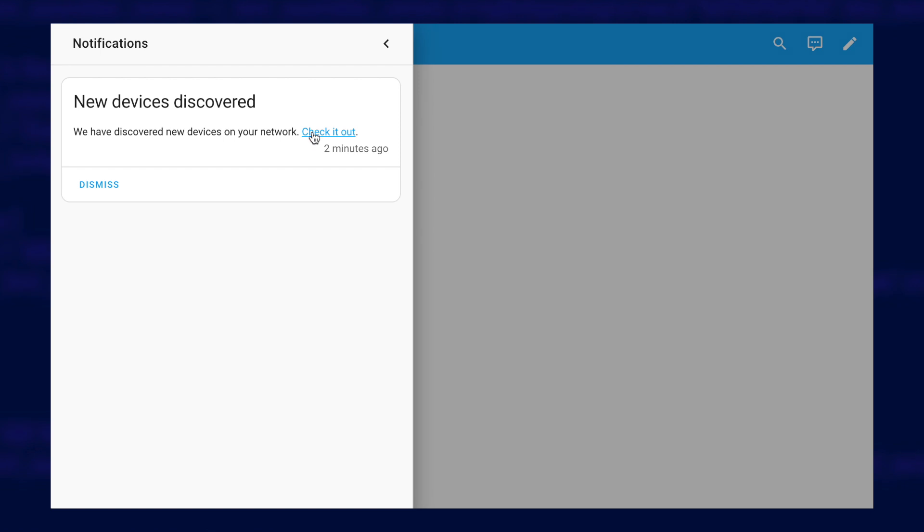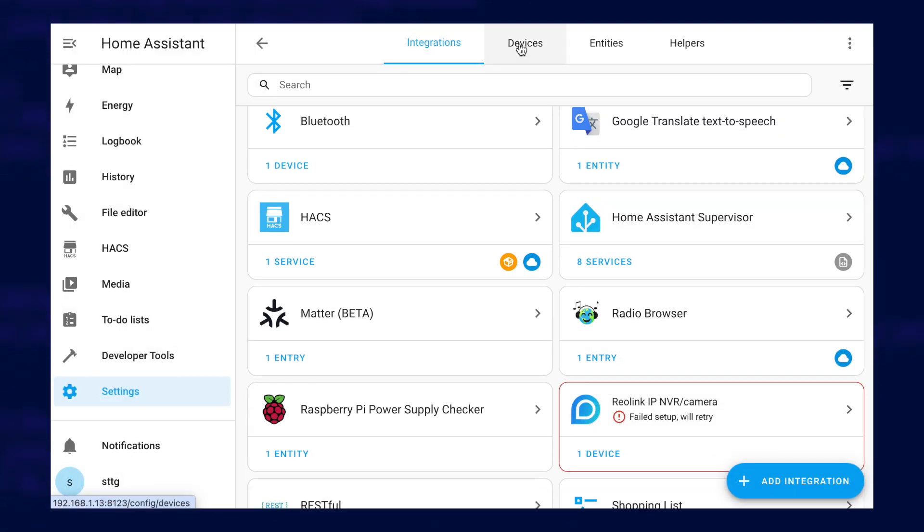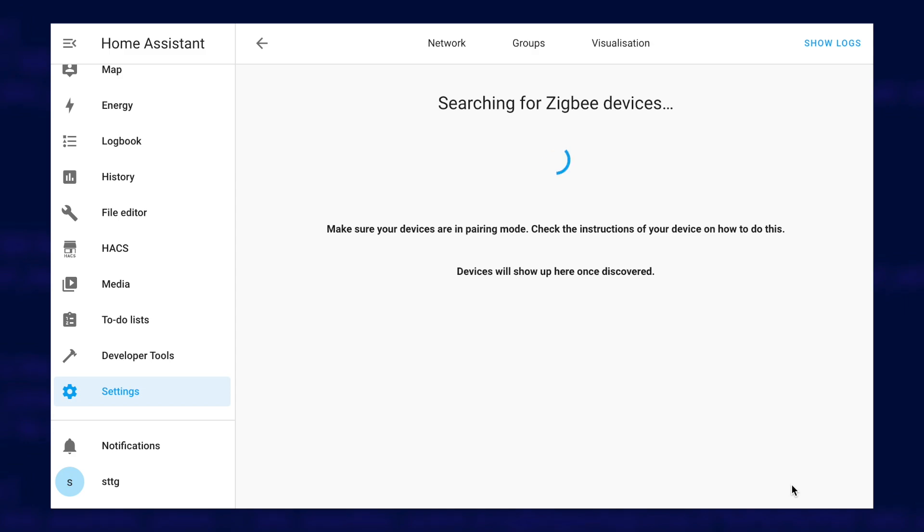There are even more reasons why this is the best coordinator. You can plug it straight into a USB port, or power it using a USB-C cable and plug in a network cable for data. It uses serial over IP, which is unreliable over WiFi — it does support WiFi but that's not recommended. Over wired Ethernet it works very well, and you can also use a PoE injector to place this device anywhere you can run a network cable to. However you connect and power it, Home Assistant will just detect it, and if you're using ZHA just follow the prompts to set it up.